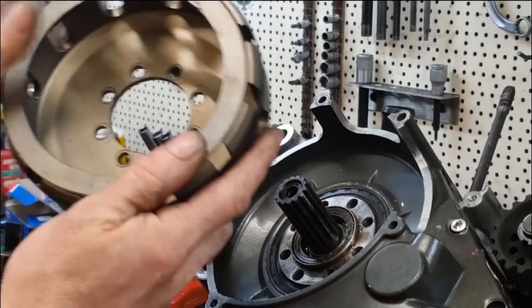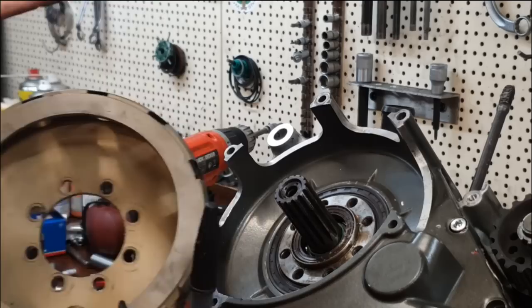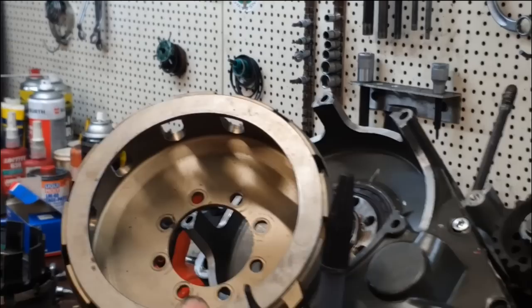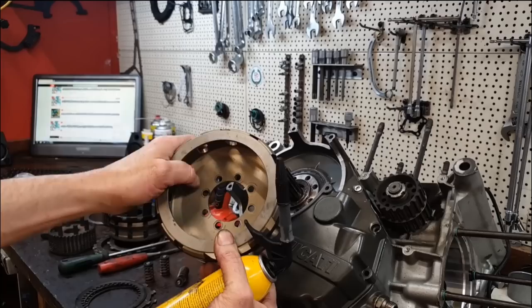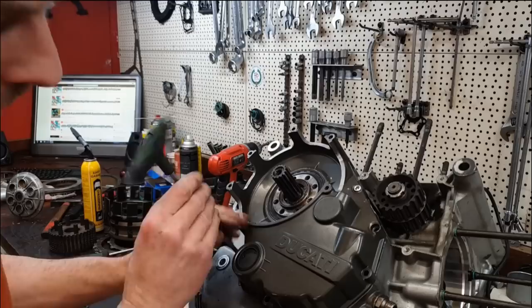You put it in, you put some adhesive on the side that has the rounded edge, put it in, put something heavy on it, so it will pressure the ring back in the end, and you make sure that it's almost dry before you mount everything and use the clutch. In this case, I took a worst case scenario possibility.